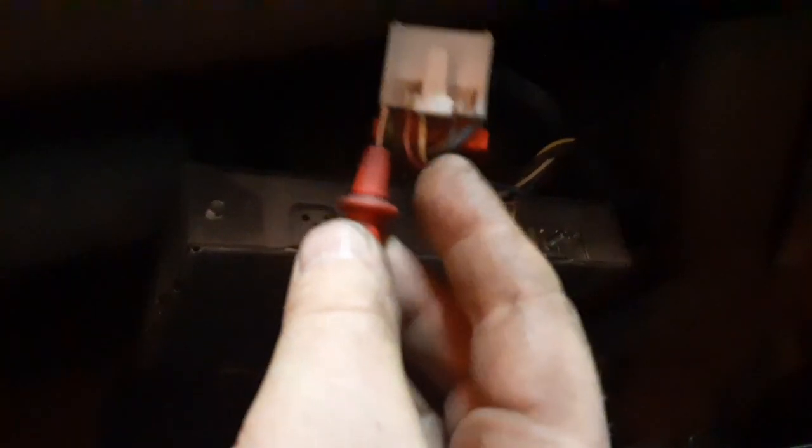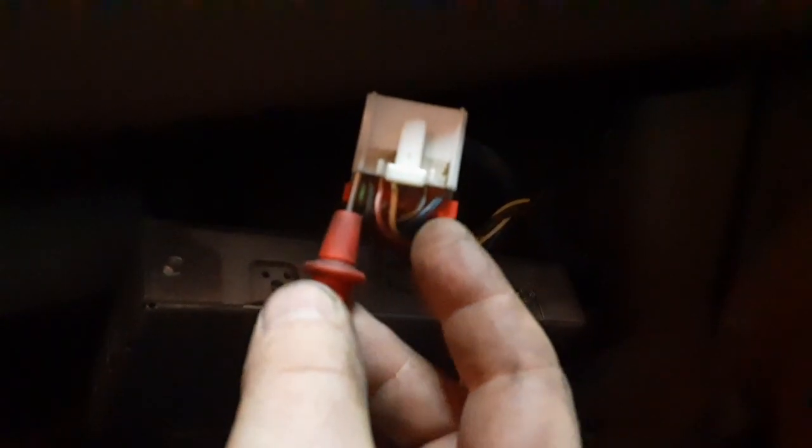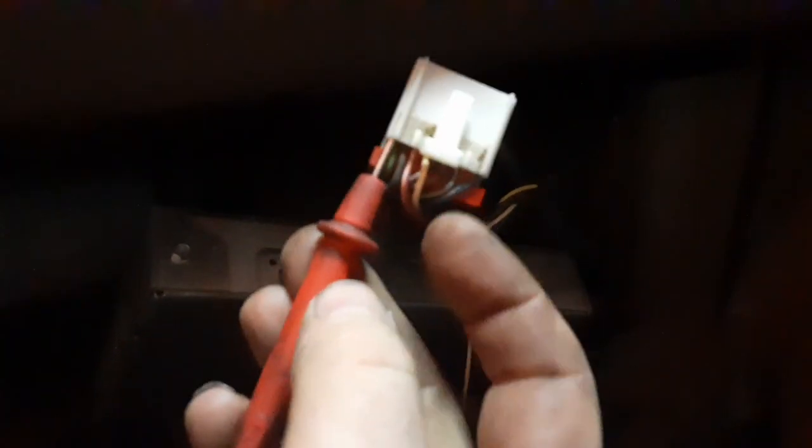In the cab, I dropped the little panel that has the computer in it underneath the glove box. Underneath the computer is this little tiny translator box or something, and that's where the vehicle speed sensor wires go - these green and purple twisted pair wires right there. It goes into this little box, and I checked these wires by sticking my meter on each wire.